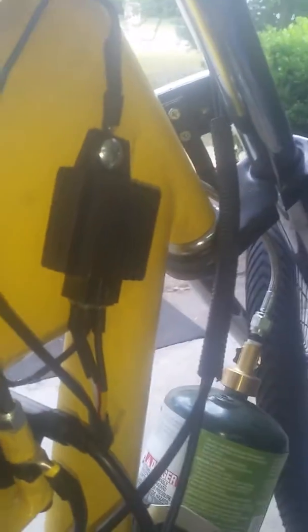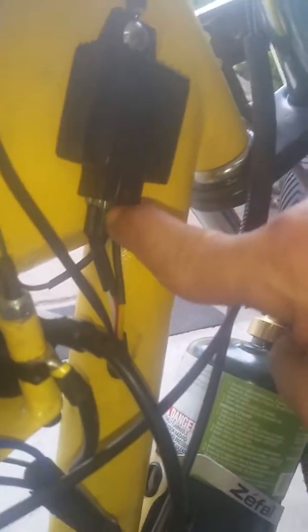You can see where my wires are all a mess right now. So for the voltage regulator — it's a four-pin voltage regulator. The top left is output, 12 volts to the battery to charge it; that's the red wire. The white wire underneath comes from your generator or your magneto. The top right wire, which is your yellow wire, is AC voltage output — it will power your lights, or in this case a flamethrower. And then your bottom pin on the right is your green wire, which is your ground wire. I've got it looped up and grounded right here.